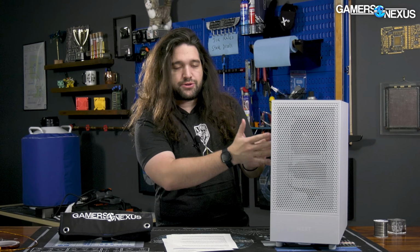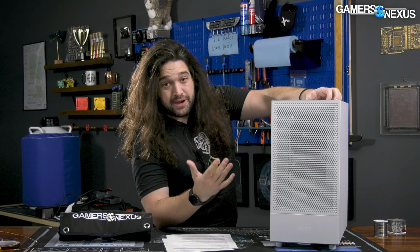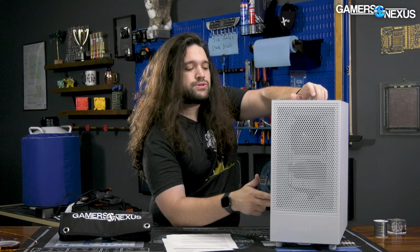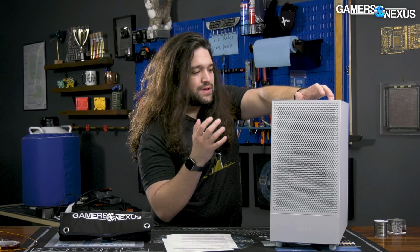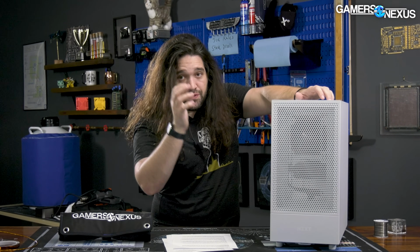And when you're talking pressure too, the pressure system is pretty evenly distributed here. In fact, the internal components are likely to contribute almost more to the pressure than the built-in fans because they're distant and few. But for pressure, what you can end up with, depending on the system configuration ultimately, is that bottom fan, you might lose a little bit of the air out the front, or more likely, you're just not going to have the strength in that CPU cooler to get air in as quickly as it needs to, to sort of flush the case and keep the internal ambient.